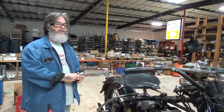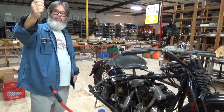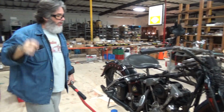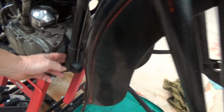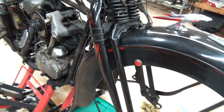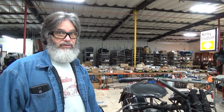Well, a '36 has a little bent tab with a bolt for support. They didn't actually make a mount on the frame. Well, '36 also has these cool little sweated sidecar loops over here instead of this whole casting. Well, in the very last of the '36s, same basic frame as this, but no fifth mount.